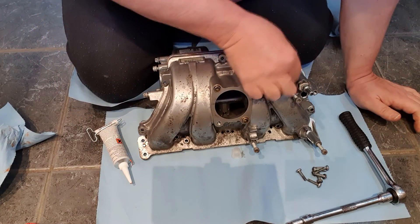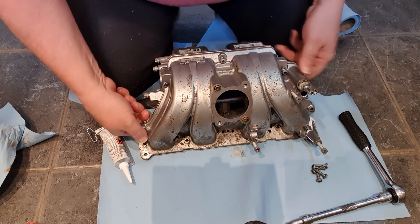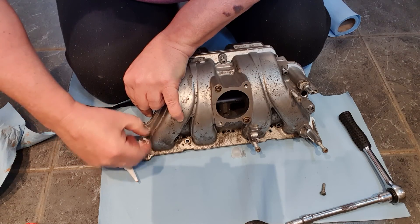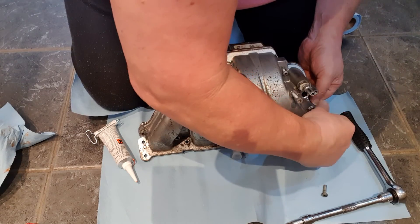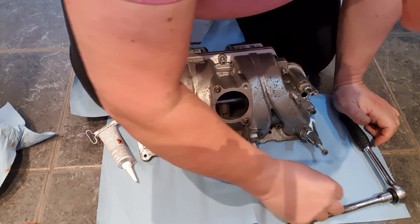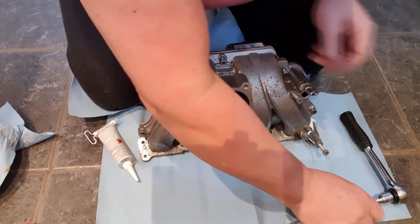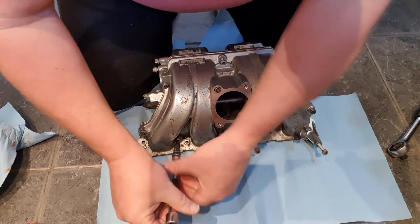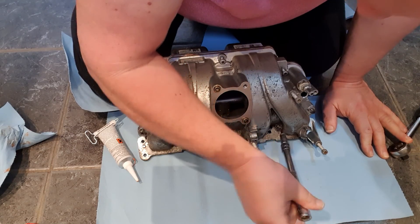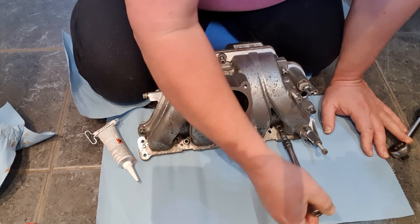All that remains to do is to put all our bolts in the holes - one, two, three, four, five, and then I think we've got six in the middle there, seven, and eight. I'm just going to knit those up lightly, just sort of hand tight just to hold everything together, make sure it's all going together properly. It's probably better with these to not tighten them down all in one place, but just do them gradually - like anything really, head gasket bolts are critical for that.